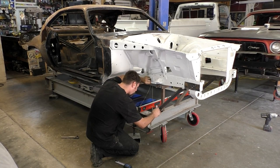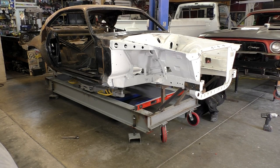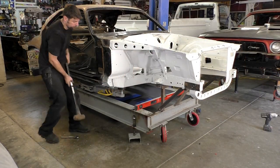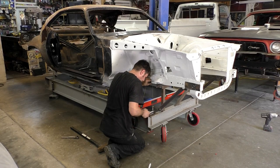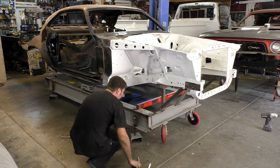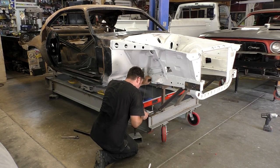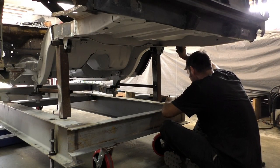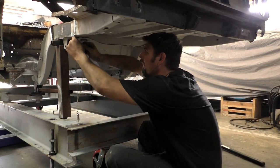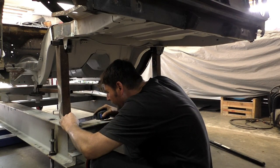We've got to go back through before we weld this car and check multiple locations to know we're squared and centered, but nothing's welded on here. I'm checking both sides, measuring with the tape measure, and then I basically take a sledgehammer - the car is not loaded on the frame jig - and we're just tapping it over, ever so slightly moving an eighth of an inch at a time and rechecking. We do all four corners of this car before we weld it up. The back is not even on the frame jig at this point - it's still sitting on the lift.